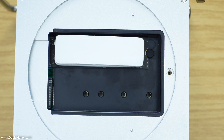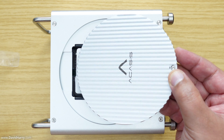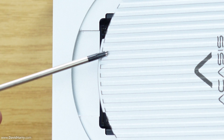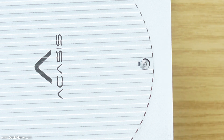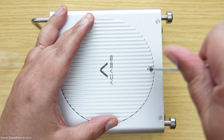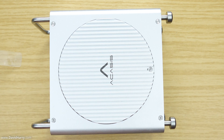That is one SSD installed with its thermal pads. If you're only using one SSD, you can now put the cover back on the enclosure. If you're using two SSDs, do the exact same procedure with the second one until both are fully installed with their thermal pads. To complete the installation, put the cover back over the SSD compartment — it only goes on one way, with a slight notch at the top that fits into a cutout. Then screw the cover back down. This can be a little fiddly, but just take your time — tighten it back on and it's all complete.